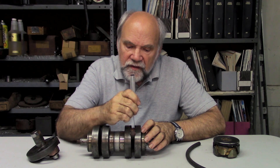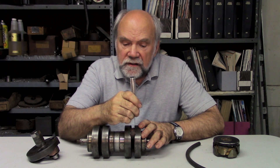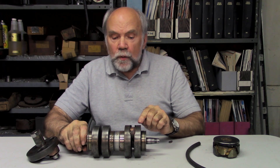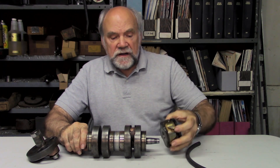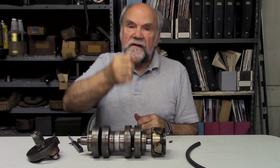When he put the feeler gauge in, instead of it being the usual 17 to 18 thousandths, he found that it had increased to 24 thousandths. He filed that away in the back of his mind. At another club race, 24 thousandths had become 28 thousandths. What was happening was the ignition flywheel was slowly walking off the crank pin, because with the extra mass of the ignition rotor, the elephant ears vibratory mode was now slow enough to come into step with the engine's firing frequency.